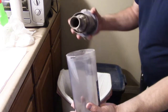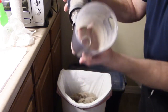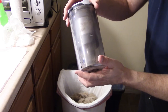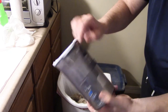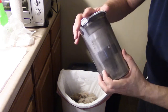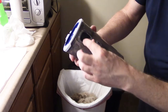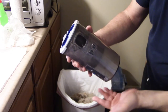Now if you want to put it together and go back to vacuuming, you want to put it back in. There is a center cylinder right there, so you want to make sure that it's in place. This isn't lined up yet, so there's a little notch right here for this. You're going to push it down and it should lock in right there when you twist it back to the right, or clockwise. You'll know you have it right because the vacuum hole is going to line up again.